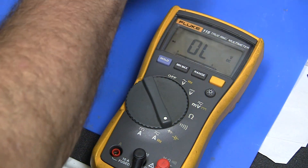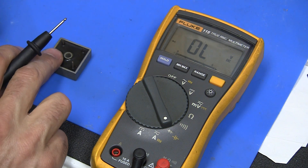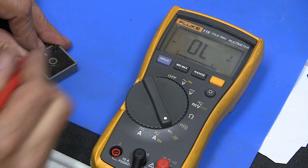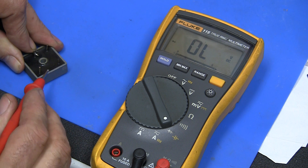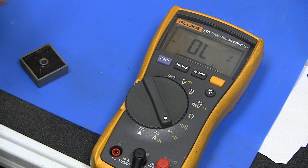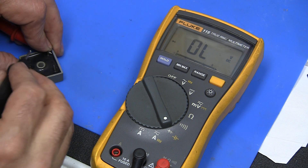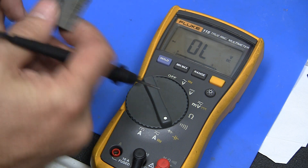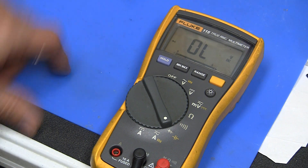Let's test one that I pulled out of this Bram Stoker's Dracula that I was working on. There's our positive lead, so we'll put the negative to that and check the two legs on the AC. I get nothing there — it's open. There's a good read right there. Now let's flip it around. Positive to negative, check our AC leads — nothing, nothing. So basically this thing is completely blown. There's one diode in there that's working. So that's toast.